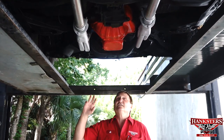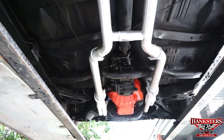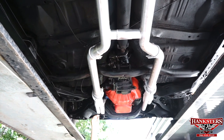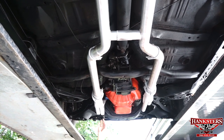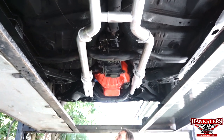The oil has been changed recently. No drips on the bell housing, no drips off the transmission. It has a long tube set of headers — looks like about inch and five-eighths. Somebody got a little close to the ground on one section of headers — scrunched them up a tiny bit, didn't rip them open, but there is a small cave-in there. That certainly doesn't affect performance compared to the standard manifolds the vehicle came with originally.